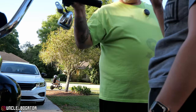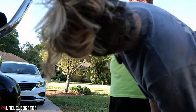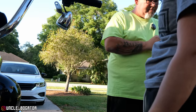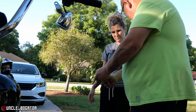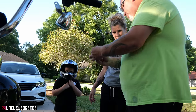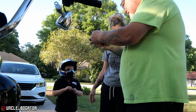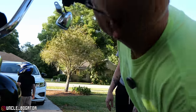Okay. This pin, look underneath there, you've got a retaining ring on it. Do you see it? Yeah. You gotta get that off with a pair of snap ring pliers. So you gotta put these two little nipples inside the retaining ring. Don't stretch it too far. But you gotta apply upward pressure to make sure they stay, squeeze it to open it, and then pull it out. You know what I'm talking about?